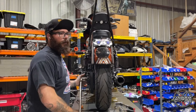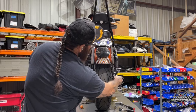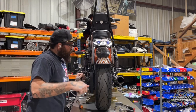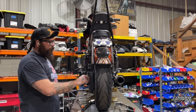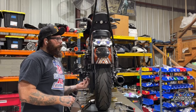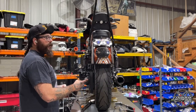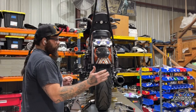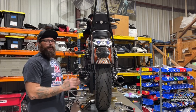I always like to loosen it all the way before I go to torque it again, just to double check. We're also going to double check that our adjusters are sitting firmly against the swing arm, because when you go to torque it, sometimes the swing arm can have some damage or the adjusters may not be set straight. You want to make sure that these are tight and all the way against their stop, so that where you set it and the tension you set it to is where it's going to stay and not shift going down the road.